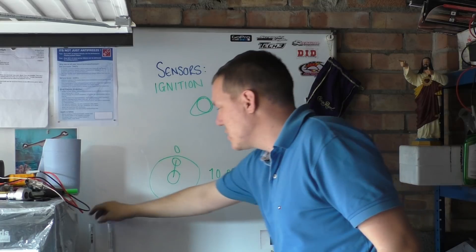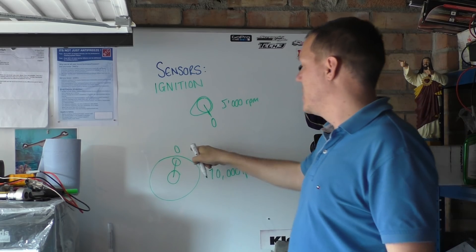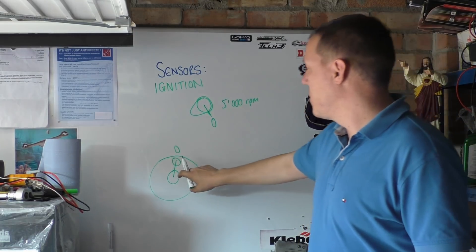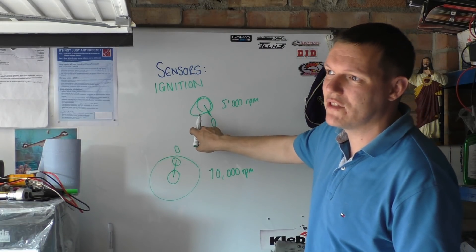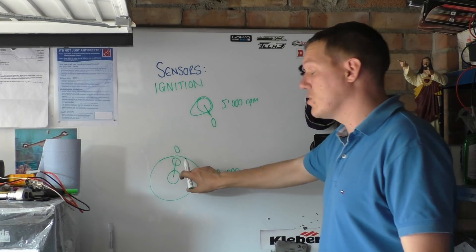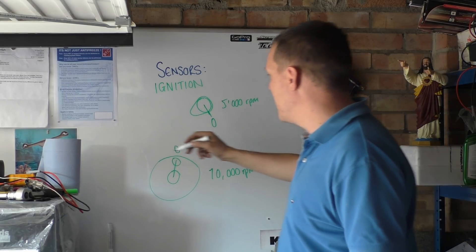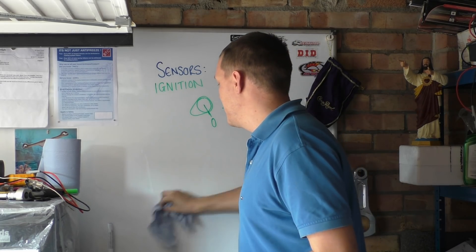So what you do is you put a sensor on the camshaft. If we just pick a line there and say zero — this will give you a count every 360 degrees on the crank. The cam will give you a count every 720. Why do we not just use the cam? Because we do need to know where the crank is, because this gives us cylinder number one. They also want to know the actual RPM of the engine, which is what's measured at the crank. It's easier to have the computer learn what's going on at the crank and then have the cam sensor in addition.